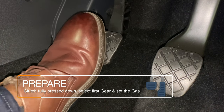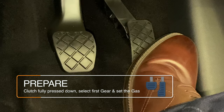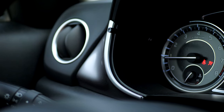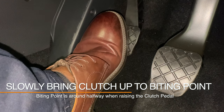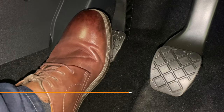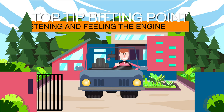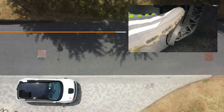To prepare the car, we need to put the clutch pedal fully down, then select gear one. Next, we set the gas just above 1000 RPM, which means pressing the gas pedal gently to around 1000 RPM or just above. Next, we bring up the clutch really slowly until we feel the biting point. This will be slightly different in each car but is normally around the halfway mark of bringing up the clutch. A top tip for knowing we have the biting point is that the engine noise will slightly change and we will feel a stronger vibration.